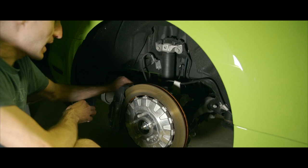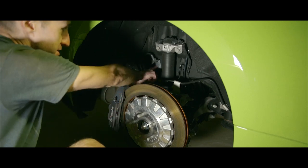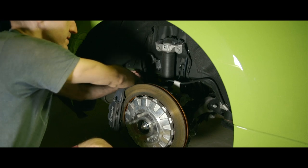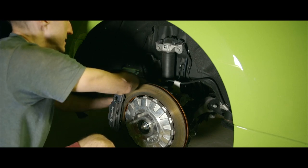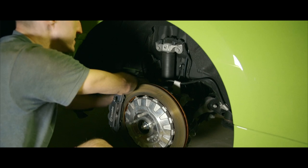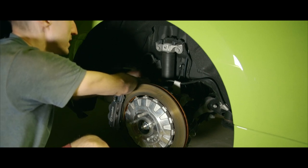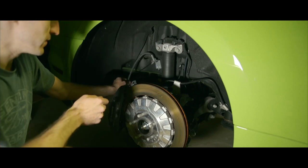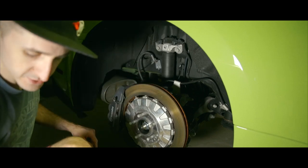You've got to take off this little bracket over here for the brake line — not just the main clip. There's a bracket down here that I'm removing right now. The reason I'm doing that is because it's going to give me more room to get the spring out, and that's going to allow me to move the line around. I'm also going to remove this as well.